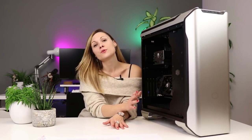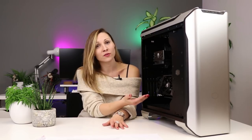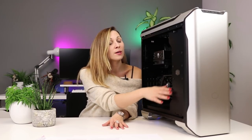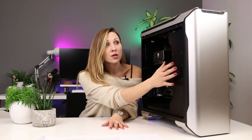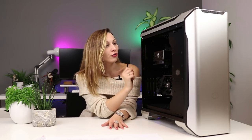The interior of the case is very interesting. They implemented a vertical chimney effect layout, which means the two 200mm fans are pulling air in from the bottom and pushing it to the top of the case. To make that possible, they moved the power supply to the side of the case toward the front, and closed the back so there is full air pressure going to the top.